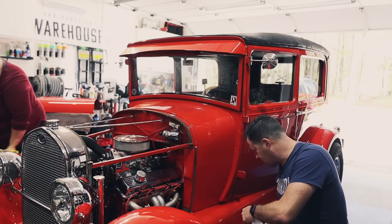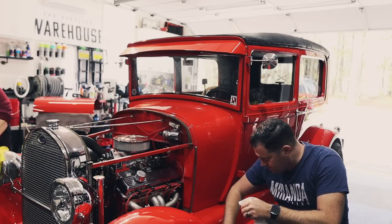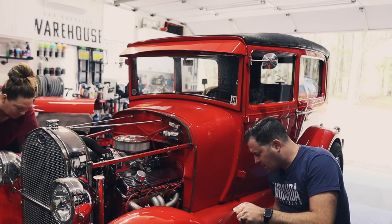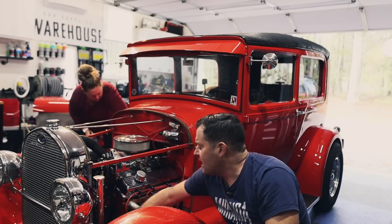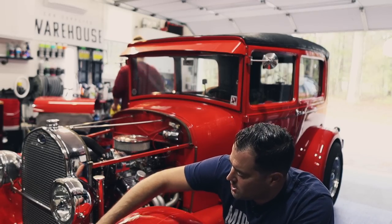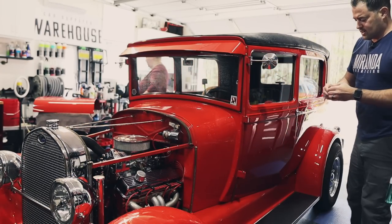I really don't think that this is single stage. But once again, once we start polishing it, you'll really see. And even if it picks up a little red, it doesn't necessarily mean it's single stage. Parts of this may have been painted at different times, and sometimes red overspray gets on other panels. It kind of looks like it's single stage when it's not. See, a little bit around the edges, but that doesn't necessarily mean that it's single stage.